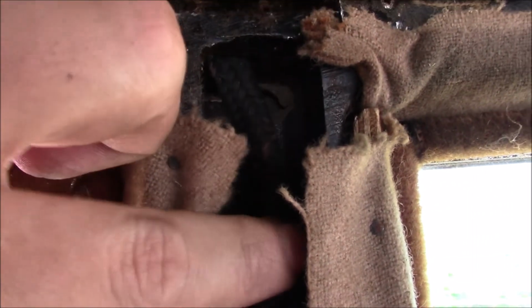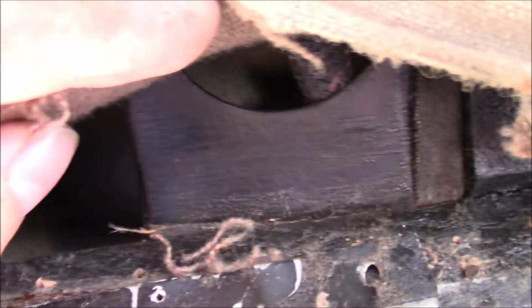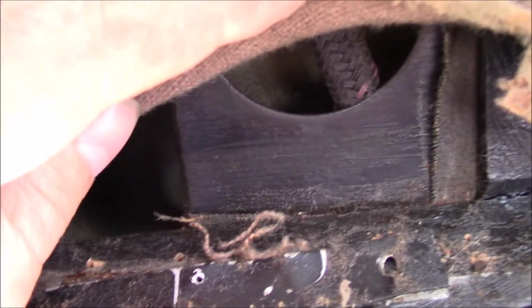What that allows me to see now is you have the wiring run from the semaphore and the B pillar in here, and it disappears up into the roof, into this part of the car's structure. This is a piece of wood, and the wiring disappears through there. Now, I know this rib runs across all the way to the other side of the car. Now, since we got the car, the trim on this side was always loose and broken. We weren't sure why. I now think it's because somebody was trying to sort out the wiring.